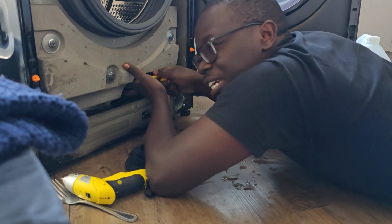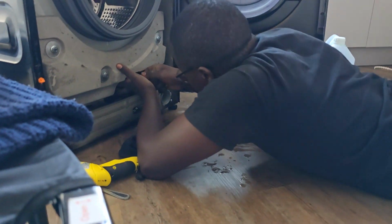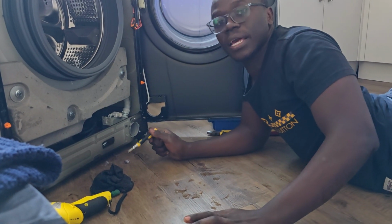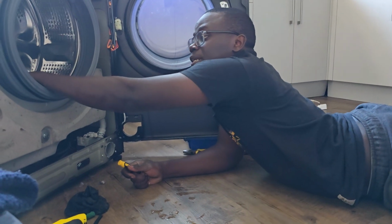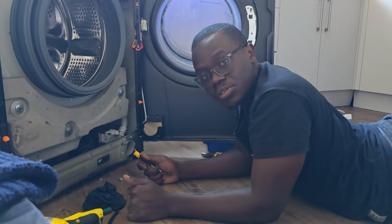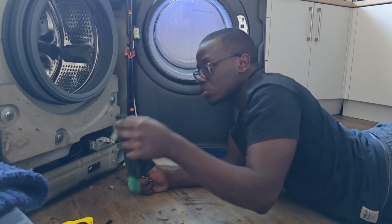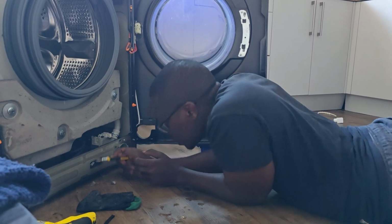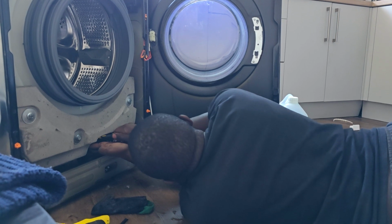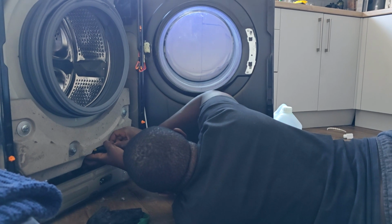First of all you have to check your serial number. You can buy a spare part online. But the easy way: when the water is clogging here, or the error E35, it means that your machine cannot drain, or down here it's retaining water. That's why you see the error E35. For me it was clogged by the socks. The water was not draining, and it was getting clogged down here under the cylinder.